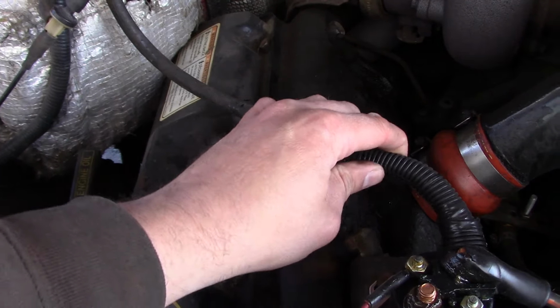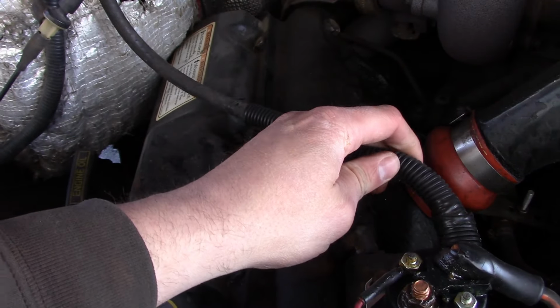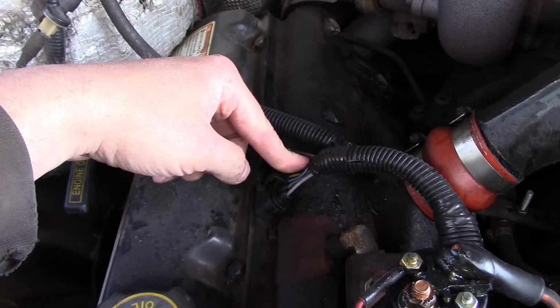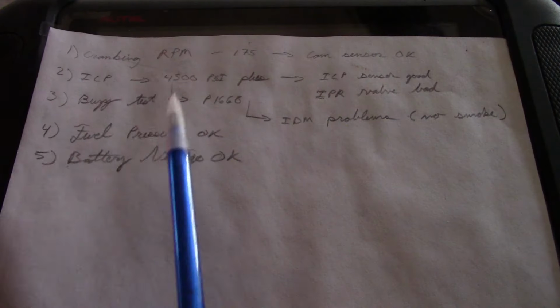Now the trick, or the catch I guess, is that you have to replace this pigtail, so you've got to chop the original harness. Now we redid that in a recent video, which I will link below, and then redo all the wiring, which on a pickup is no problem, but on that van chassis that could be an all-day job.